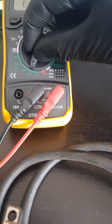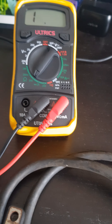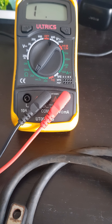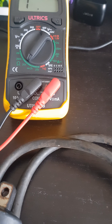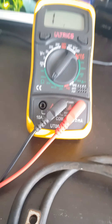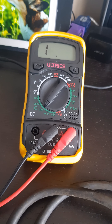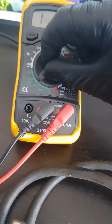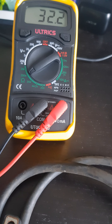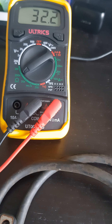I don't know what the exact resistance spec is — I've had a look online and couldn't find anything. I'm assuming you guys will have a record of it somewhere. But seeing as it's on 20 and I'm getting that reading, that's indicating possibly a bad coil pack. And even if we were to be reading off that, it's still probably out of spec.